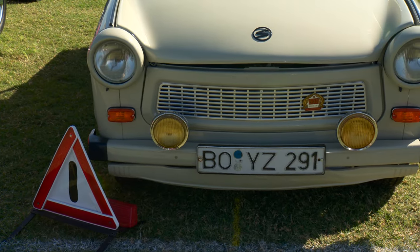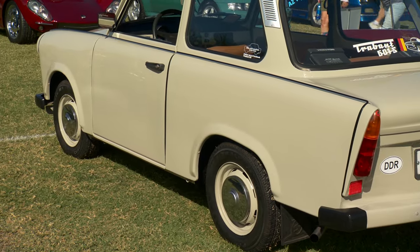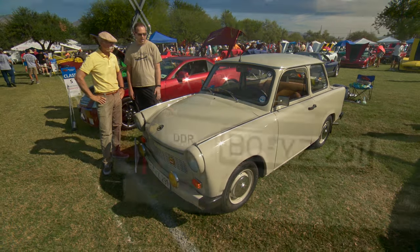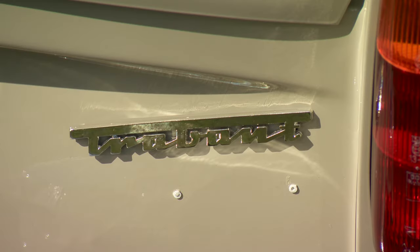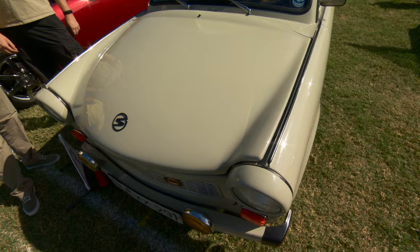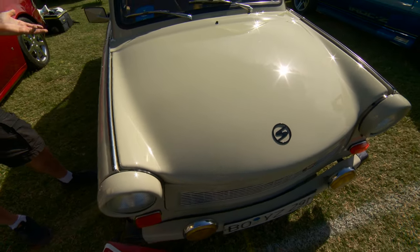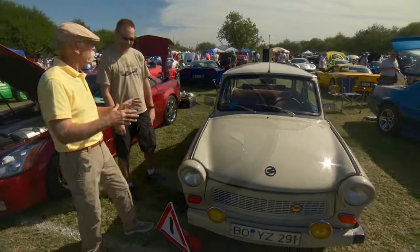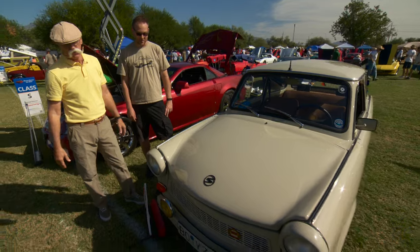These cars are not steel cars, and they're also not fiberglass cars. Some people say they're made out of cardboard, but that's not correct either. They're made out of duroplast. Duroplast is basically a wool fiber jacket that was ground up - the leftovers. They compress it with a resin and heat to make the body panels, which are then bonded to the light bit of steel on the car. So it's a composite body made from old wool coats - you could technically call it the first green car, if you can call a two-stroke car green.